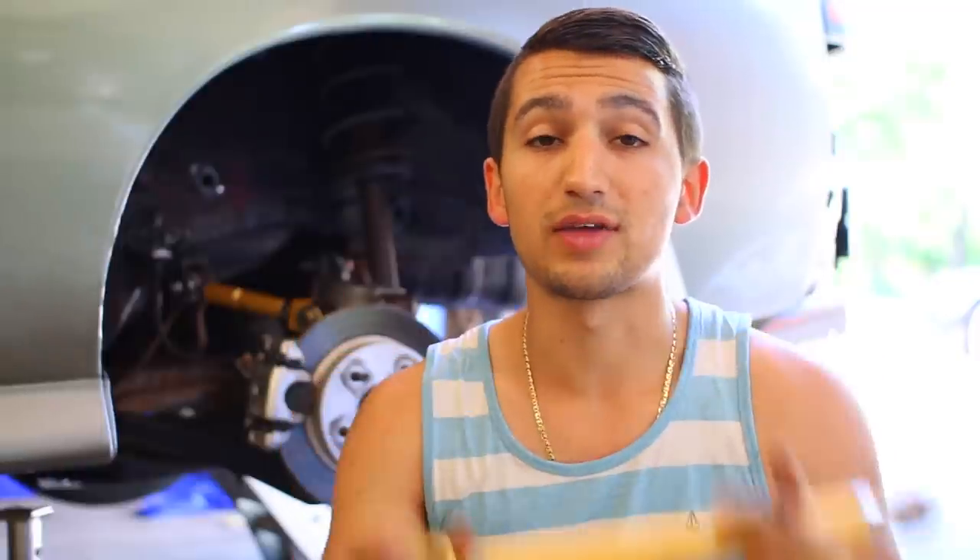You might wonder why not just buy a set of eccentric bolts — that could have worked if I were leaving the car at stock ride height, but because I want to install coilovers and get rid of the tire gap I have to use adjustable arms so I don't kill my tires quickly. Bad camber will wear out your tires, but bad toe is even worse — if the tire is scrubbing sideways while trying to move the car forward, it'll be gone in no time. Once you get it dialed in, you won't have to worry about that at all. If you have any questions about the video or the products, check the description box for links. Throw any other questions in the comments and I'll be happy to help. Thanks for watching — catch you in the next one.